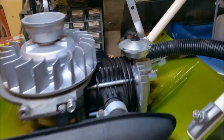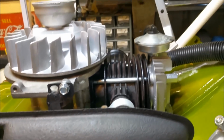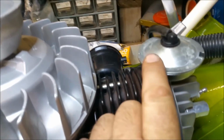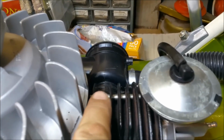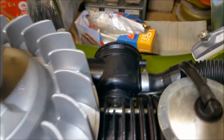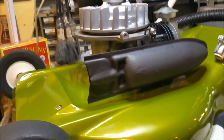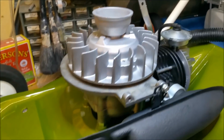Isn't great. I'm not proud of this. I've put this torpedo muffler on. The thing is a bit of a paradox because it's got a G4 carby on it. I can't avoid that because I needed a port for the decompressor, and the other G3s I've got don't have that port, and nor does the manifold down in there. So I've had to use that modern carburetor on a pseudo old machine. That being said, I know about it. Well, now everyone knows about it. But it doesn't worry me that much.